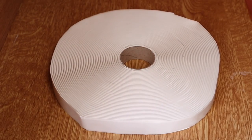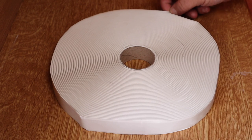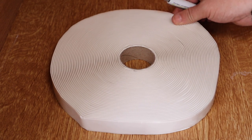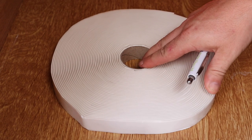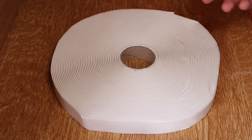What I'm going to be doing is just removing the aluminium trim from along the side of the van, removing all the rubber, cleaning the area and then inserting a new seal. What I'll be using is this roll of mastic sealant strip. It's a sealant strip that never ever dries — it's like a putty sort of material and it's really flexible and durable. Double sided as well so sticking it shouldn't be a problem.